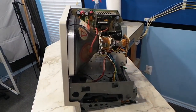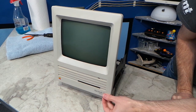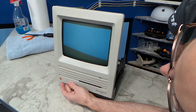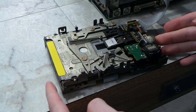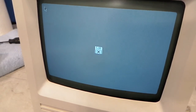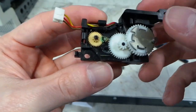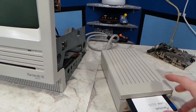I reassembled the computer with just enough parts to make sure everything is still working after my cleaning. At first it didn't appear to be working, but I realized I needed to check the brightness control since I had been messing with that during cleaning. There's the picture — looks like it's still working. I wanted to see if it would boot from floppy now, but unfortunately it would not. The drive just moves around but can't seem to read the disk. It was also making a bad noise when it tried to eject, and I discovered some broken teeth on the plastic ejector gears.